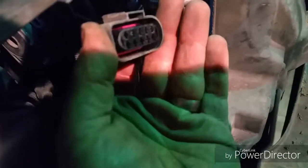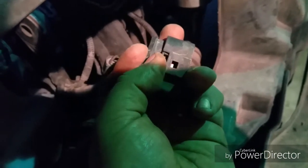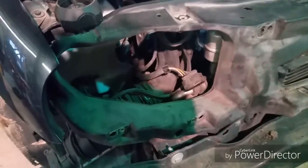Then there are some lowers. Once we've got some bulbs to swap out, we'll be done. It's important to mention that these clips are pretty substantial. There's a little tab right there — it actually has a lift and then there's a little hole. I put a screwdriver straight down in it and just pried backwards a little bit. I heard it click and was able to really easily slide that off. I felt like it was on there pretty tight, but that's how I did the clip.